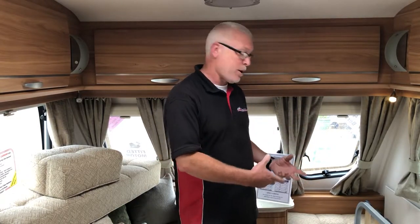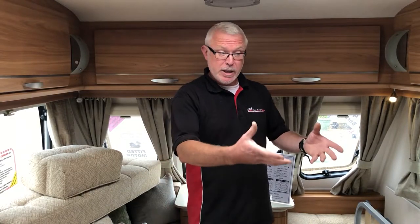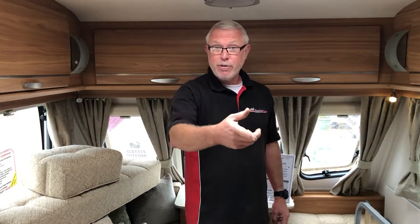I've come into the caravan and opened the hot tap to fill up the water heater — very important to do that first, certainly before we put any heating on, as I've explained in another video. Once you get a free flow of water through the kitchen tap, then go to the bathroom tap, then through the shower head. Make sure the air is out of the system, not just on the hot but also the cold.